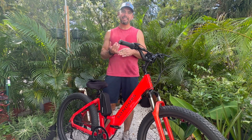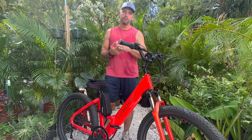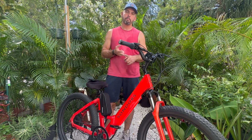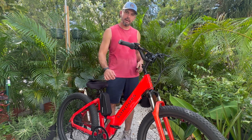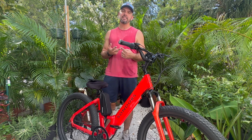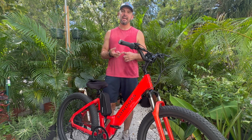The kit itself is going to be 50 bucks and the battery is under 200, so for around $250 you can actually double your range with your Sondors bike. If you decide to go with a rear rack battery, check out the extensions — I'll put a link in the description below along with the kit and the battery. You are not isolated to this battery; you can get any 36 volt battery you want. Just make sure it matches 36 volts and has an XT60 adapter to connect to the balancer. Please give us a like and subscribe — TikTok, Facebook, Instagram, ElectricAllWheel.com.